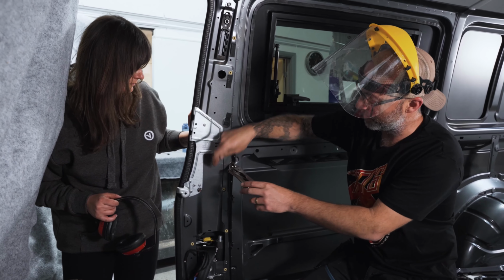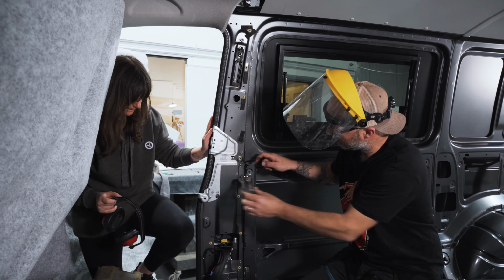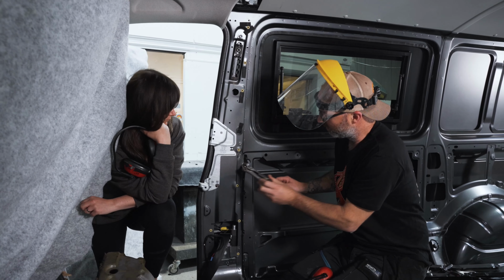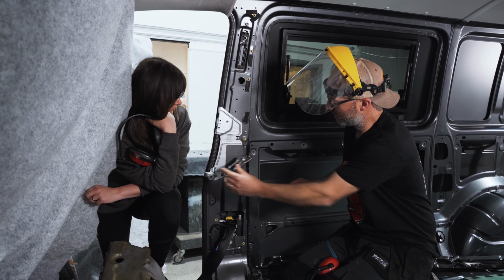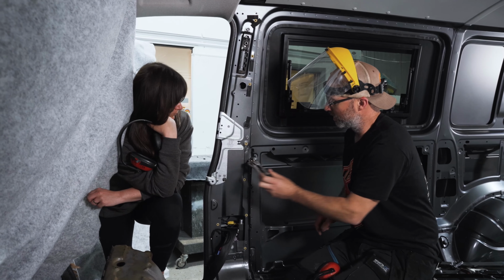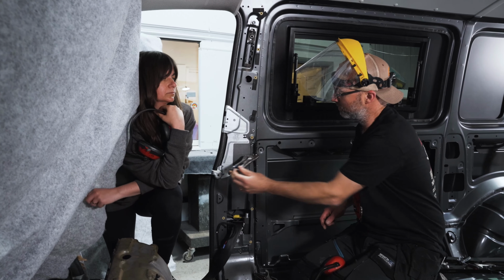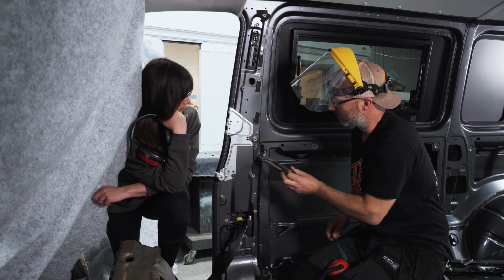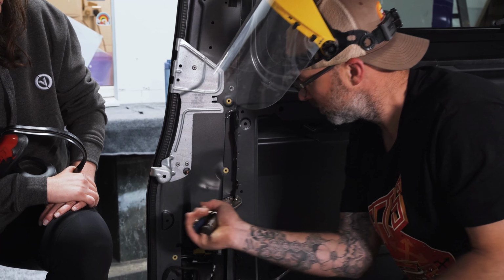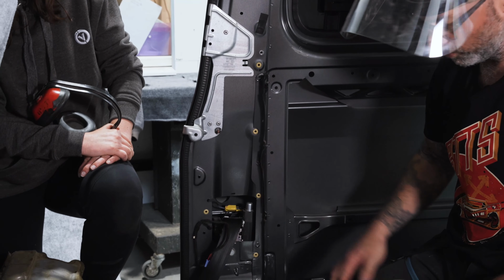And then you weaken the metal around the braze, but I'm not a big fan of that, because as you can see, it's actually flexing this whole pillar. There, you see that? Yeah. But as you can see here, if I keep twisting, and again, there's no real effort, it's just a set of vice grips, that will eventually get weaker, and then it will break. All right, so it's probably the least messy way to do it, but you're going to have to work hard at it. If you do choose to use that method, you're then going to have to clean up the spot welds and any surrounding metal around it. But what I have done is move that metalwork away from the areas I want to get in with either the grinder or the hammer chisel.